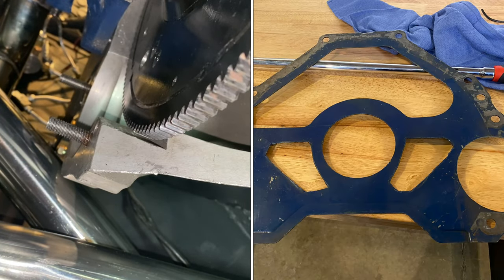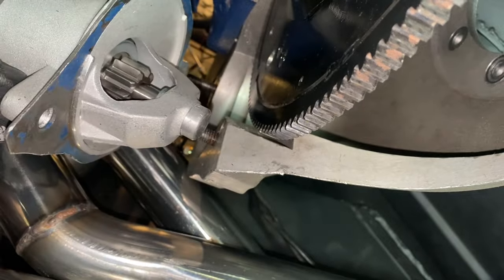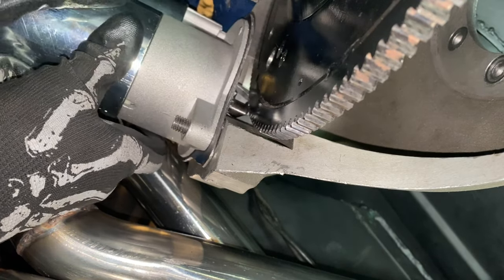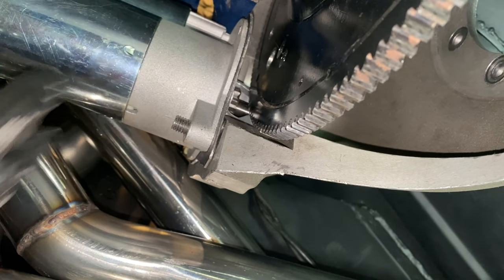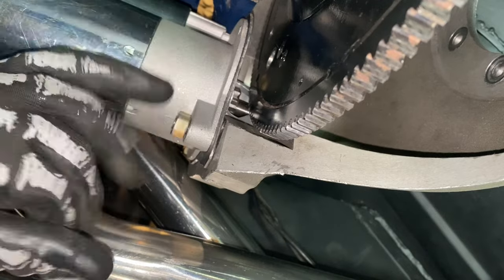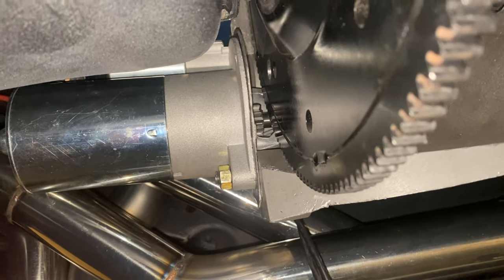It's also missing the shim that goes here. So I made a shim — you can see I put it around the starter. That's the 65 thousandths I needed to have it back to where the pinion pulls in. Now the starter is shimmed the way it was from the factory, at least closer than I had it before, and now only missing a distance of 25 thousandths. We're going to bolt it up and see how it works. Ford's have a block plate; GM doesn't, Mopar doesn't — at least that I know of.